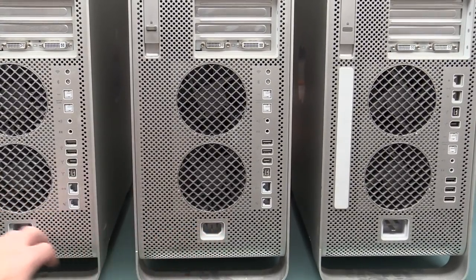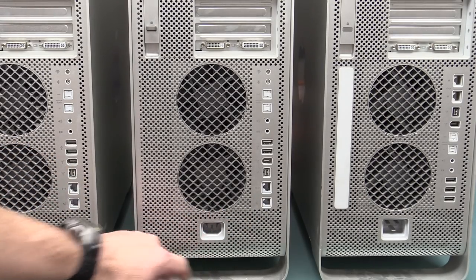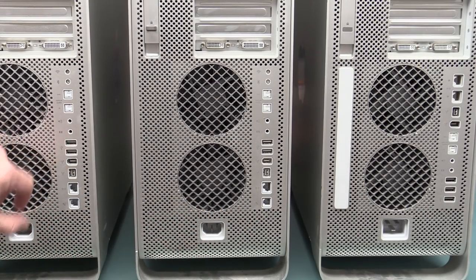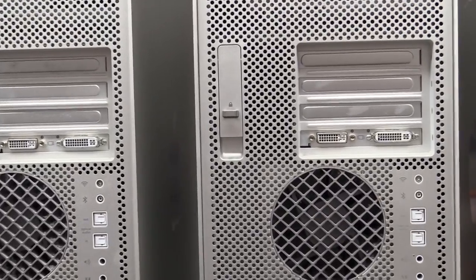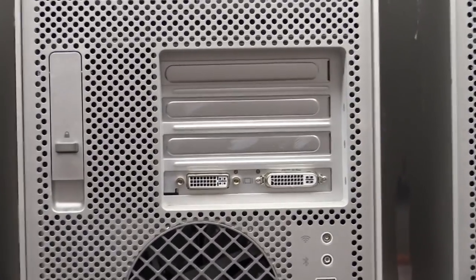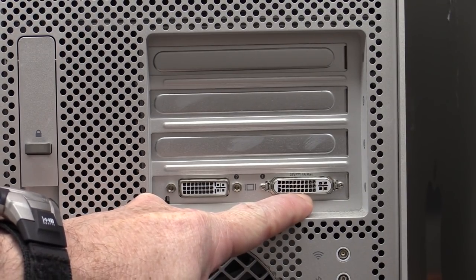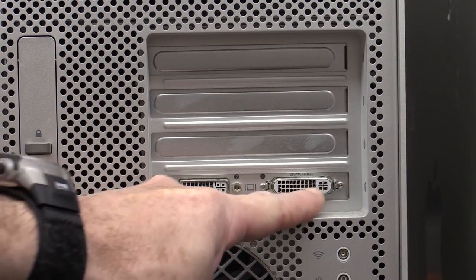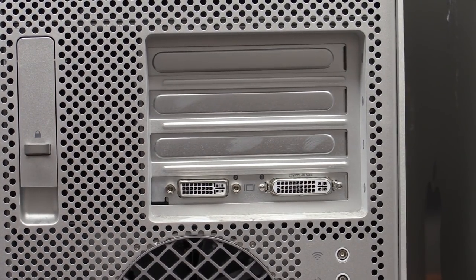These two, for example, are basically almost identical machines. They've actually got a modem interface, regular IEC power connectors, just a couple of USBs, FireWire, digital audio and stuff. And they've got, if you look up here on the graphics card, a regular DVI connector, but then they've got this pain in the ass DVI M1 connector, which is combined like a USB and DVI, and I actually don't have an adapter for that.